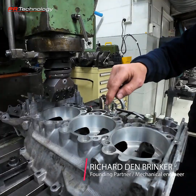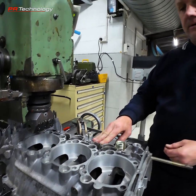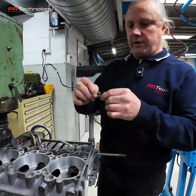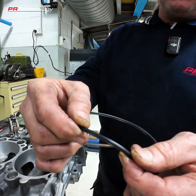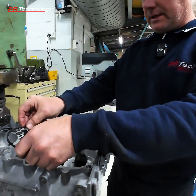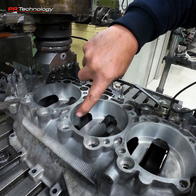When you put a 3.8 litre barrel and piston kit in, there's a little o-ring that looks like this — it's called a quad ring. It's actually got four points; it's not a round o-ring, it's a ring that's got four edges on it. The quad ring sits inside the crankcase like this.